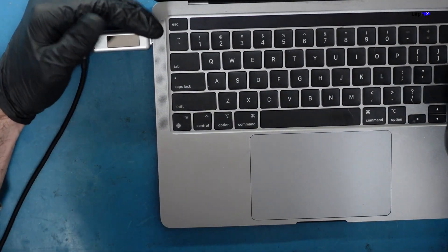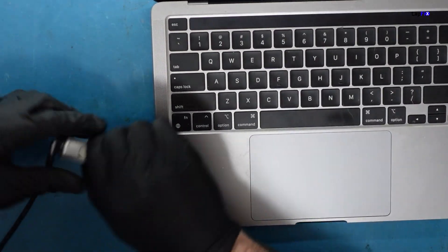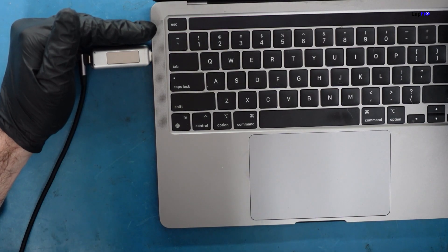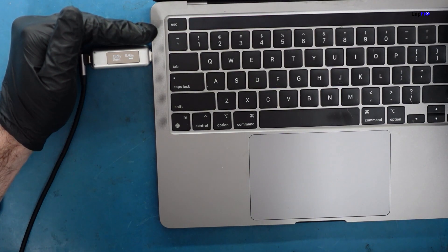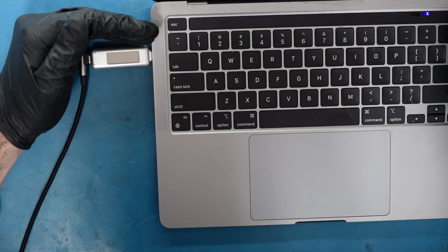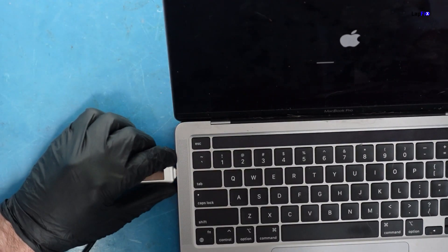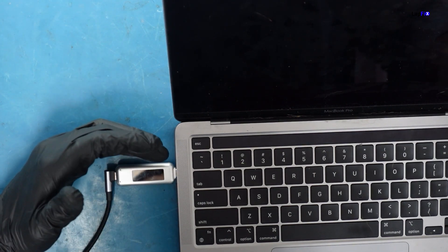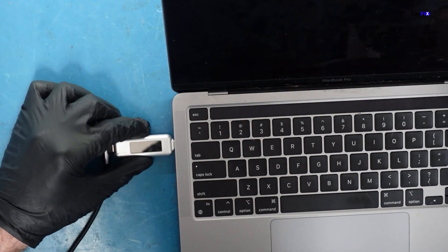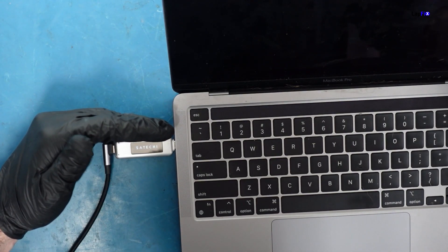Nothing can mean a lot of things — most likely the port is damaged. The bottom one works; I'm getting five volts and it turned on, then it turned off. I'm getting a logo there — juice did flow for a second. Plugging in again and getting nothing. There's maybe a little bit of battery charge that just went through, but there's a problem. You can see it keeps turning on and off on the voltmeter — there's a problem mainly with that port.